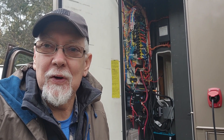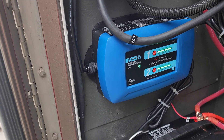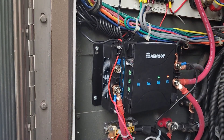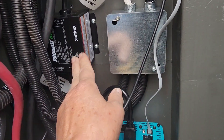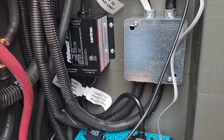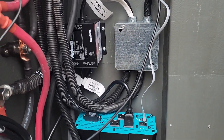I'm back at Joe's — you saw me working on his ambulance about a month ago in Washington State. I asked him to get a few more parts and he's got them, so now I'm going to install them. One thing I asked Joe to buy is a new smart battery charger with two outputs: one that charges truck batteries and one that charges house batteries. This charger will charge lead acid, AGM, and lithium. The inverter Joe bought was not a smart switch, and on his vehicle only one plug was hooked up to shore power. So I got him to buy a smart switch and hooked up all the electrical outlets to the electrical box on the side. When shore power is plugged in, even if the inverter is turned on, it won't draw any power from the inverter, which is much better for him.